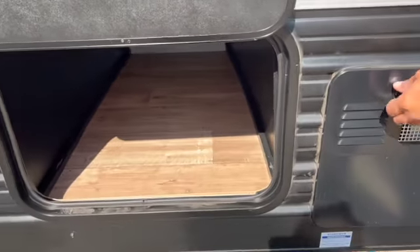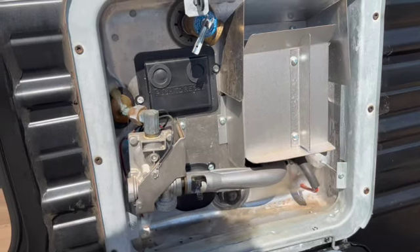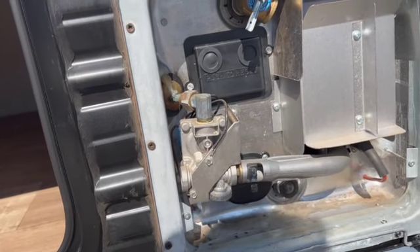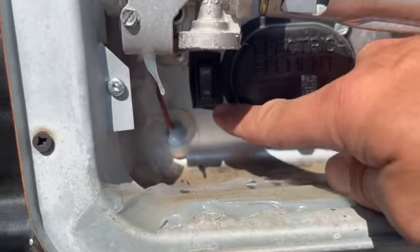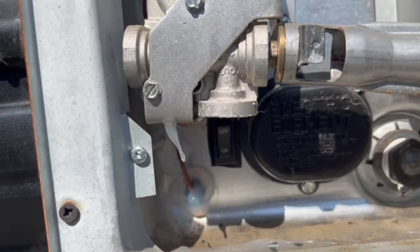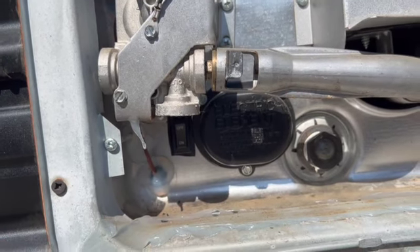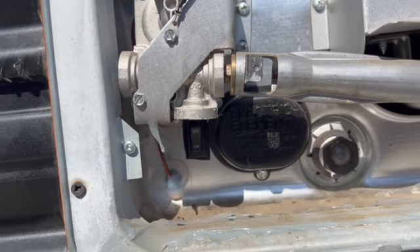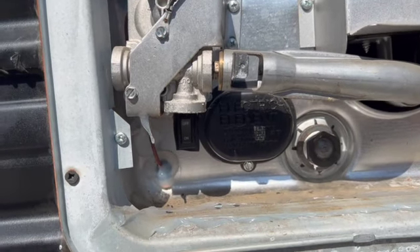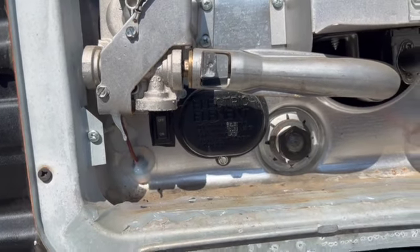Here's a little storage compartment. This next one is your water heater — it runs on electric or propane. Right now if you have full hookups to electric, you come here and turn on this switch. There are two options: you can run it on propane or electric. On electric you just turn it on and wait 10 to 15 minutes for the water to get hot. If you go dry camping with no full hookups, you use propane — the switch for that is inside.